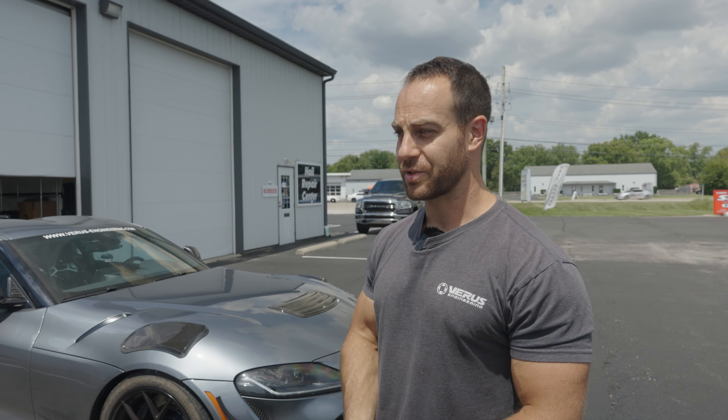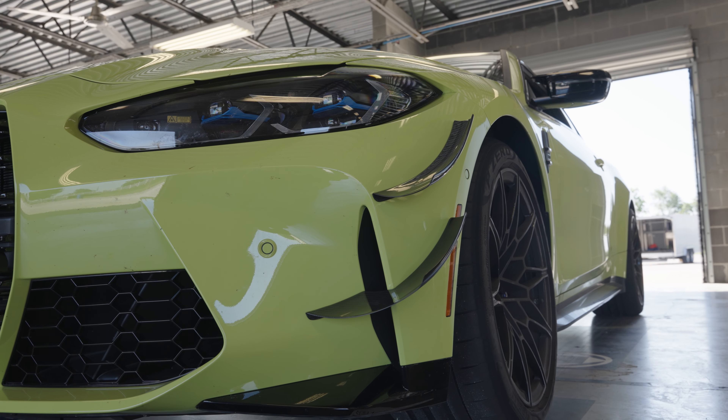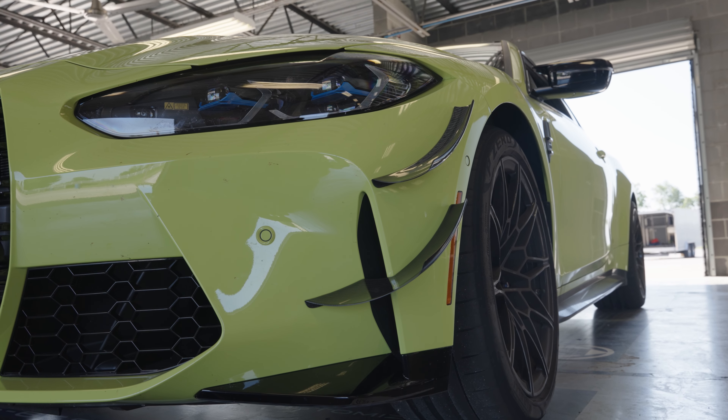So that's where we're actually getting a lot of the benefits — not on the units themselves, but what they do down the side of the car. The other way these actually produce downforce is a little bit of high pressure on the top side and low pressure on the bottom side, so you get forces acting on the units themselves which push the front of the car down and shift that aero balance forward.